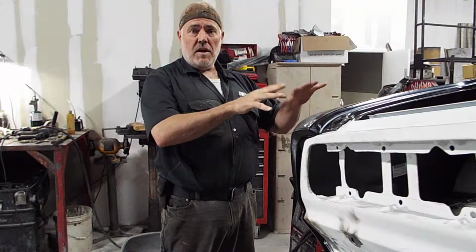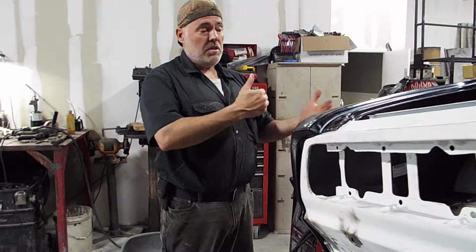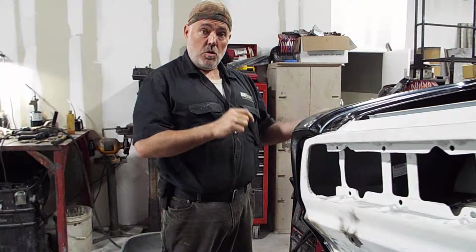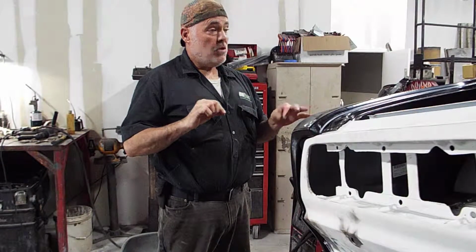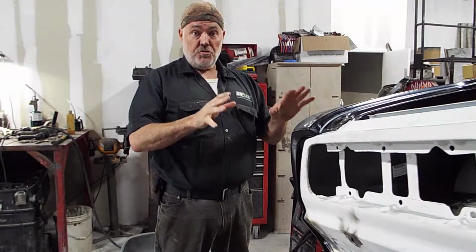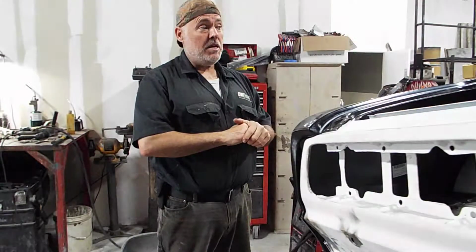So I've found that the wheel houses on those cars are often not even welded together, and I'm going to show you in the video that the outer wheelhouse needs to be firmly attached to the quarter panel, and they need to be welded to get a firm, strong car. All the cars that I build here, I make sure that happens with proper alignment and proper fitting. I'm going to talk to you now about what I'm finding on these panels.